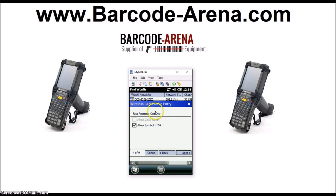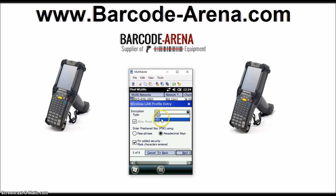You can just leave Fast Roaming enabled — click Next. Encryption type for most factory state Wi-Fi network security settings is AES, and that is our case, so we'll leave it at that. Check with your network administrator to verify how your Wi-Fi network is encrypted — it is either going to be TKIP or AES. You have to have that selected correctly to match your network in order for it to connect.